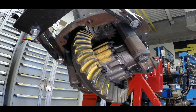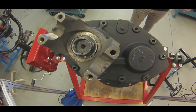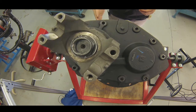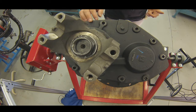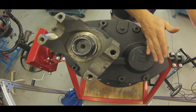Looking at the top side of the interaxle differential, we have our input yoke coming in off of our transmission. That input yoke drives down through the input shaft, down into the spider gear of our differential. From there it drives through those differential pinion gears up to the axle side gear, which is actually the helical drive gear, and the helical drive gear will then drive the helical driven gear, which is in line with the pinion.